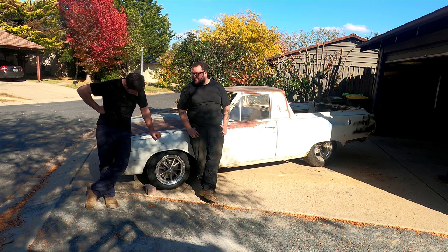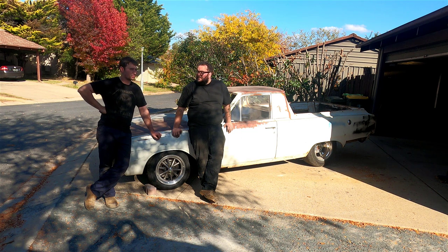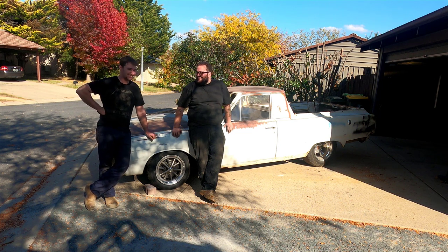So that's pretty much it — front discs, the big jobs are done. There are still a few big jobs to accomplish, but at this point it's just finishing up some little stuff. All the half-started stuff that we filmed earlier we're going to fully finish, so there'll be a lot of part-two episodes. That's AU front discs with 15-inch wheels. One job we do have left is we've still got to mount the boosters — we're still running the Falcon factory front booster and master cylinder, so it should pull up just like an AU Falcon. We might get that inherent brake shudder, we don't know yet.